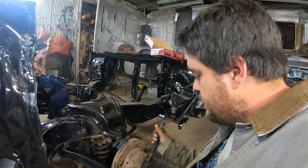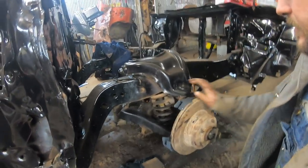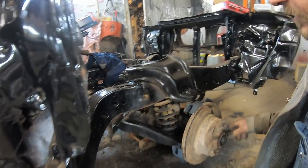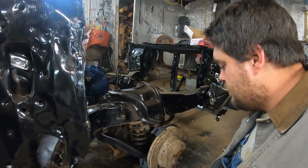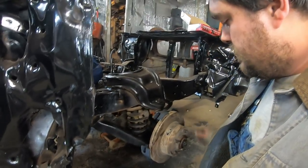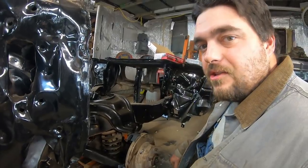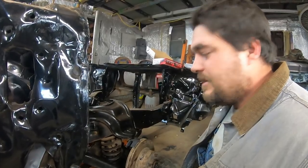When you're setting these wheel bearings, give them a little bit of mustard. Push that grease down in there. Then back them off. Let them freespin. Then just make sure that they spin relatively free. This one is probably a little bit crusty still because I'm lazy. But it's okay. Then make sure you tighten to where the cotter pin goes through. You always want to tighten to it. Don't loosen to it. Make sure you're at least on a tightened stroke. That'll make sure that it's not trying to back off on you and wipe out that family of 12 on the highway.